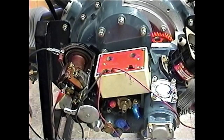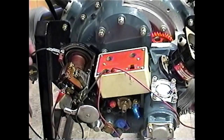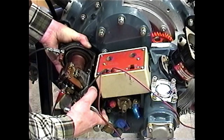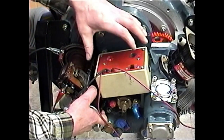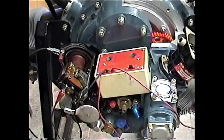With the crankshaft set at 31 degrees before top dead center, we now check the magneto timing. The points are not open yet, so we adjust until that's the point where they're just opening. We tighten the magneto up, and the magneto and distributor are now timed.